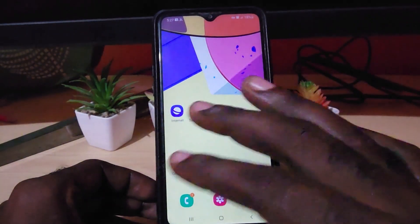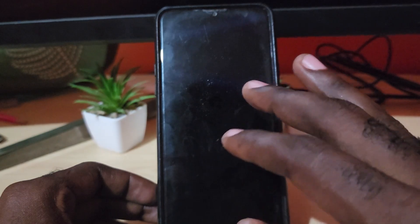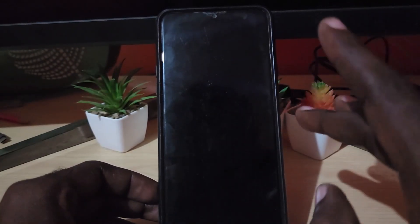This is better than a full-on reset in that instead of erasing everything off the phone, it will only erase stuff related to network, meaning you'll have to go back in and reconnect to all Wi-Fi and Bluetooth. In some cases, if your mobile data settings are not pushed to the phone, it does require that you set it up again from the beginning.